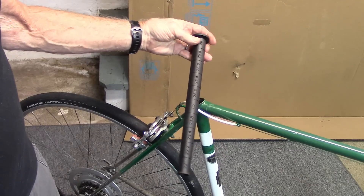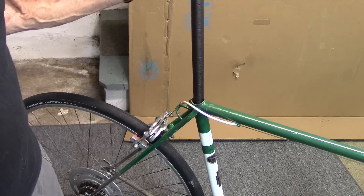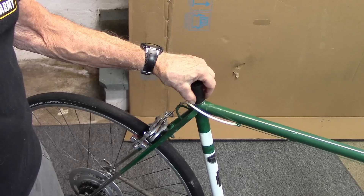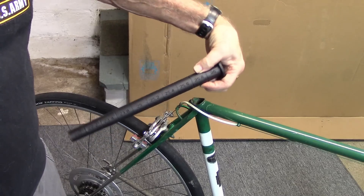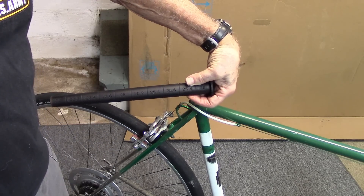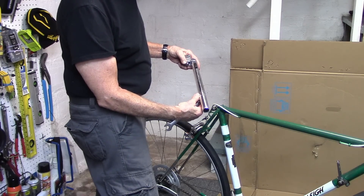The way this works, we take one of the tubes that fits and carefully let it slide into the seat tube. Note the point where it stops — which is halfway on this one — at 25.8. So we'll utilize a seat post whose diameter is 25.8 millimeters.